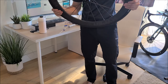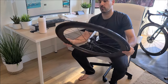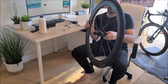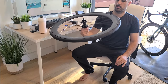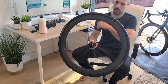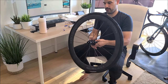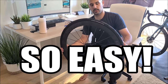After installing the valve core back with the sealant inside the tire — since the bead is already seated — all you have to do technically is just pump air back into the tire. After you're done with the application and there's some pressure in the tires, it's very important to shake it and make sure the sealant is coating the tire from the inside throughout. That's how easy it was to set both wheels up tubeless.